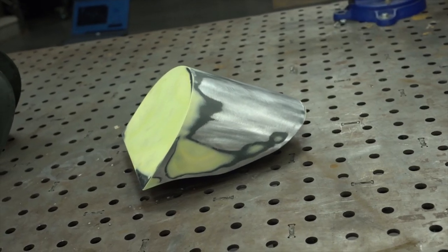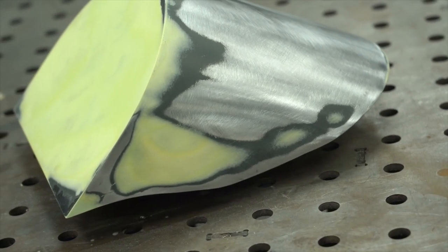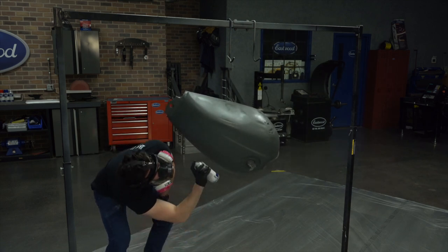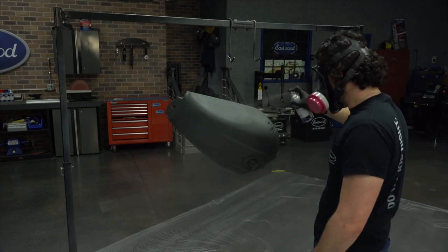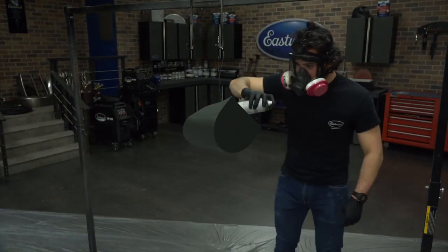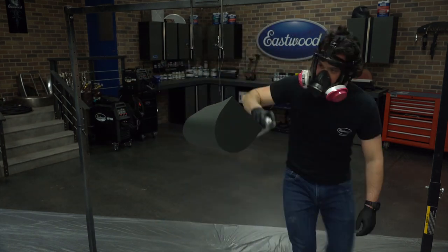I know we didn't show you the cowl, but that's just saving you from having to watch the same process twice. You put it in primer, you add your filler, you sand, and then you're done. So there you have it — the filler's done. Like anything, the more you do it the better it's going to look, the more proficient you're going to get at it. I'm happy with how these two pieces came out, and JD did an absolutely fantastic job for not having a ton of experience. Now we've got to get them into primer — we're using the same 2K DuraSpray. We had those leftovers from those cans, got them covered in another two or three coats, and now they're protected until we're ready to paint.